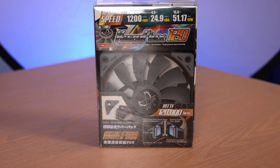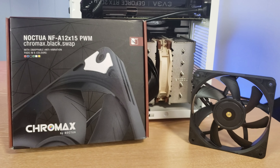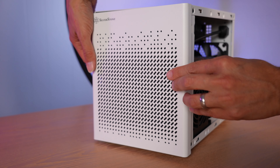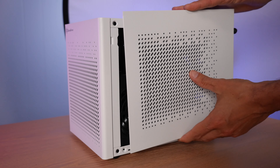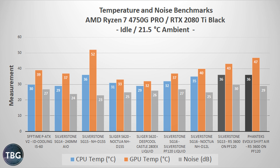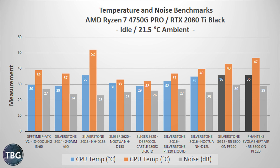When you can see the whole thing running with all the cables tucked away, it looks all right — I'm actually amazed that it's this neat inside. But I do like the idea of an SFX unit; there's a whole lot more space. Once I tested this, I realized I could go with a much better cooler — the NH-D12L from Noctua. Now, some of you are already thinking about the Scythe Fuma 2, but that was an absolute no-go for one basic reason: the front fan would absolutely get impeded by the cables coming out of that power supply, even in an SFX unit.